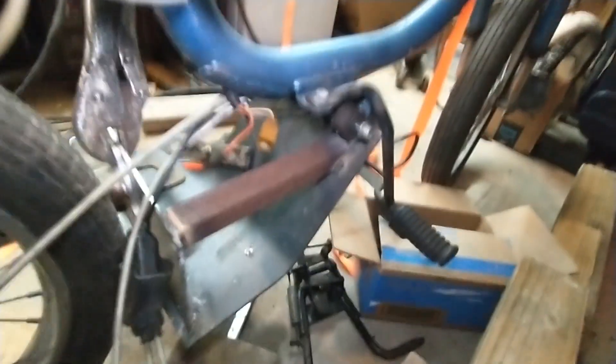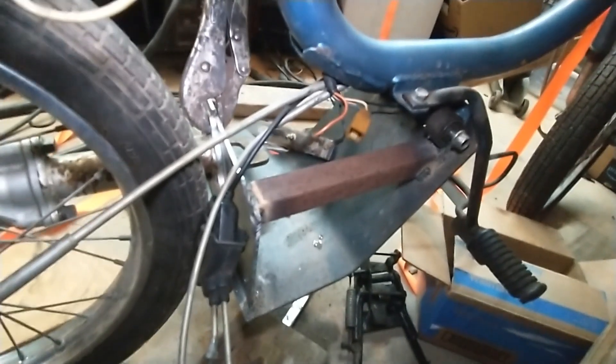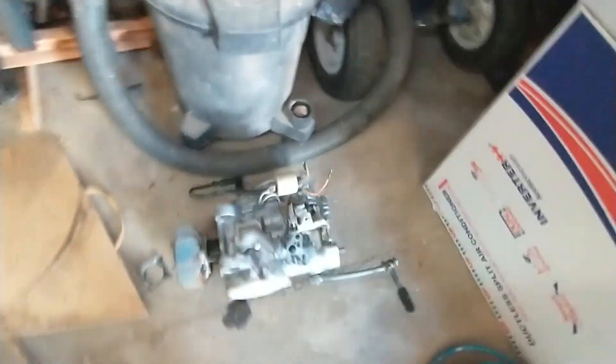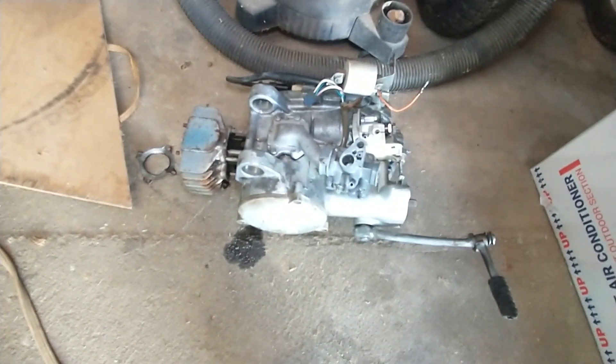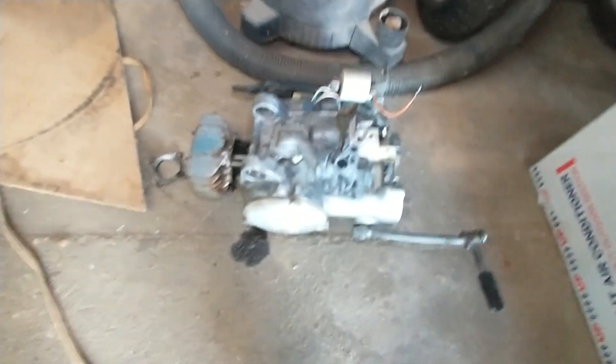This bracket had to be built to the same size as the motor to keep everything aligned properly. On the other side, he added a reinforcement to keep it from moving forward or backward. It's still going to need some work to finesse it to the right size. The old motor is removed - it actually probably could have been fixed easily, but we'd much rather go electric than listen to a 50cc two-stroke since they're obnoxious.